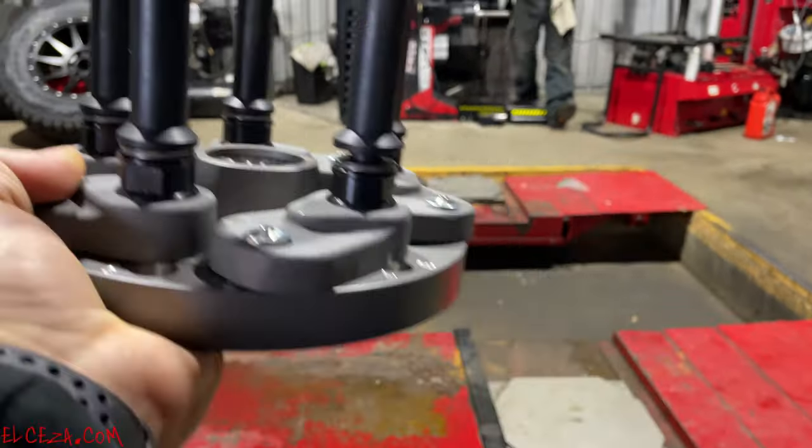Mount assembly on balancer. This is the part where RTFS comes into play. Does everybody remember what that stands for? Read the screen. RTFS. Got me? Okay. Mount assembly on balancer. Position balancing at 12 o'clock. So that is going to be 12 o'clock, right there.